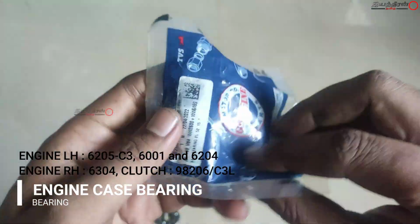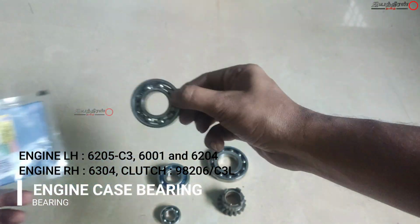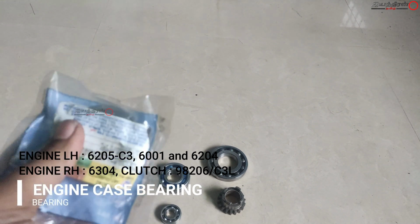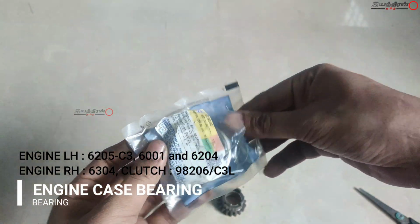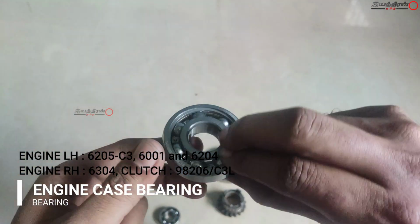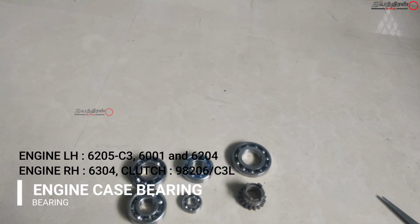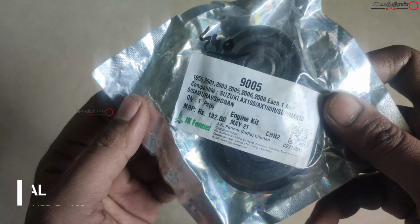And these are all the bearings, you can see it is from TVS brand, some are from Hero brand, and other things. I prefer SKF bearing. They have a standard. If you say these numbers you can get the same size bearing from any brand. It is same as MRF, which manufactures for many OEMs. Likewise these bearing companies also manufacture for many other brands, they just need the number.